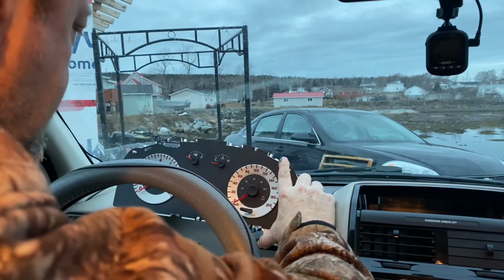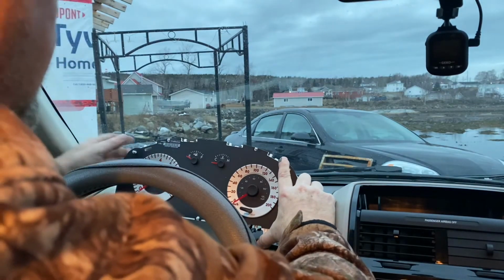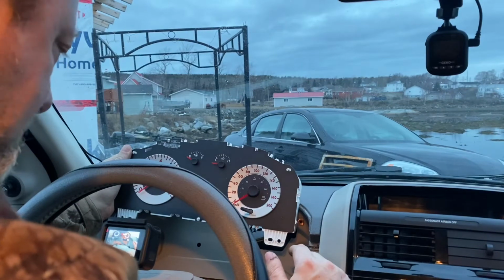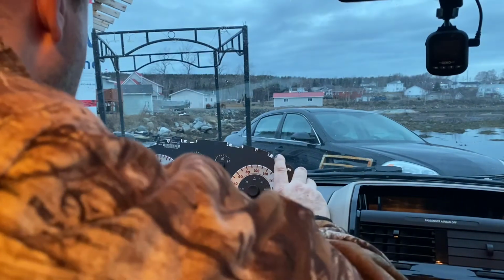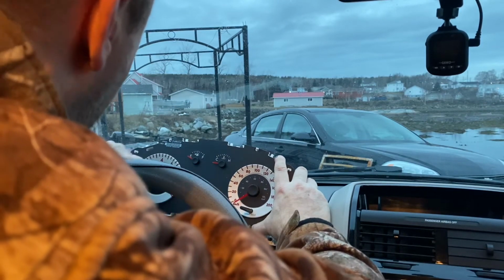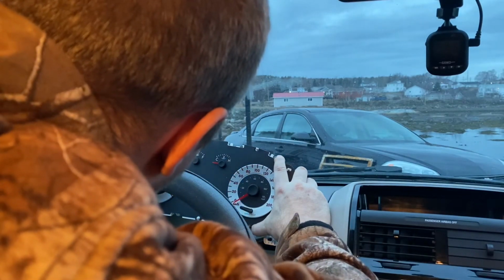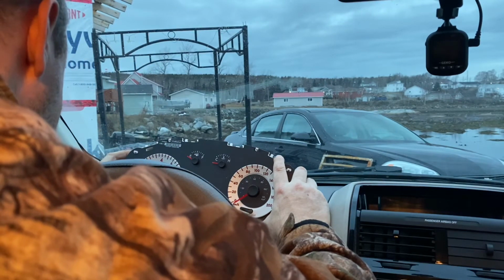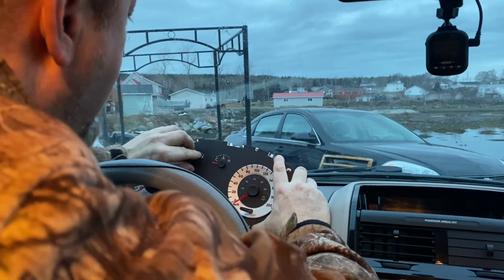If you stop directly at the zero, when the vehicle recalibrates itself, it's going to be above the zero. I know from experience that you just go a little bit underneath the zero. Once I connect the dashboard back together and turn the ignition forward, keep it for a minute or so, you'll see that she'll calibrate herself. The stop for this one is the same thing. Every function here is the same thing. So pull out your piece. It's the exact same thing I did with the speed gauge. You can set it anywhere you want. Roll it back until just a little bit below zero. Same scenario. The gas gauge is supposed to reset itself.